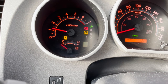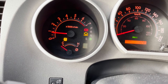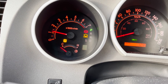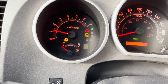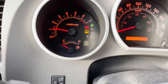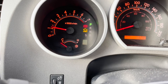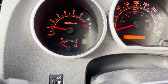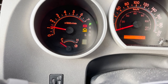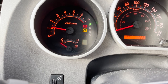Applying the brakes, go back and forth between neutral and drive until you see the drive light come on. Put the car back into park and wait for the D indicator to illuminate, which tells you the transmission is in the correct temperature range to check the fluid level. The D light off means below 37°C; D solidly illuminated means 37–44°C which is ideal; D blinking means above 44°C and you'll need to cool the fluid down for several hours before repeating.